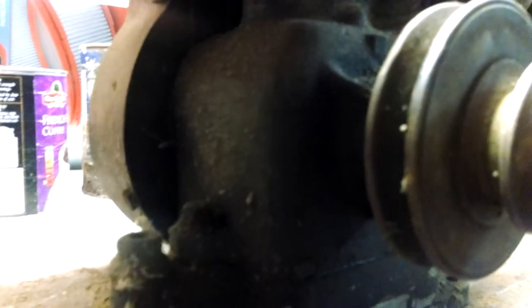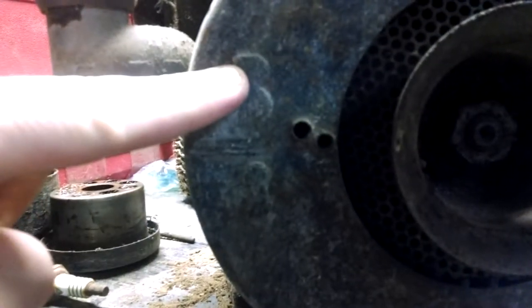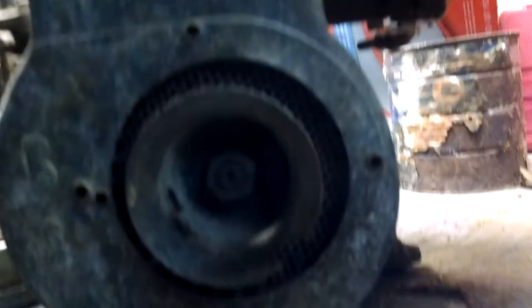It's in pretty decent shape, but the bad news is I do not see an ID on it anywhere. I'd like to know what type of engine this is. I know it's not a model N, because those are way older and the fins on the head are much different. A lot of people talk about FH models - this may be an FH, I don't know. But it's a horizontal shaft, it's a bottom sump. What I think's really neat is here on the fairing it's got an old B&S, which makes me think it's a Briggs & Stratton motor. And it has all the outer markings of the Briggs & Stratton motor, which is pretty sweet.